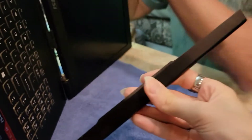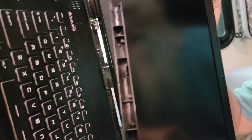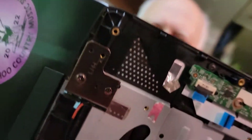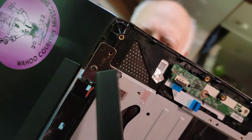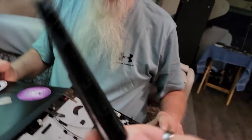This front piece has to come off in order to get to the keyboard. Actually, you have to get to the hinges. To get to the hinges, this piece comes off — it protects them and you can't pull the hinges out from this side until you take that off. It comes out, so this will not come out until you take this piece off. It just clips in.